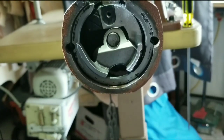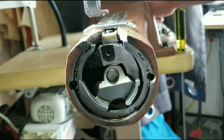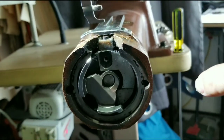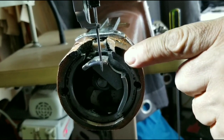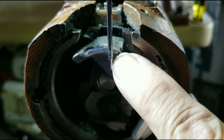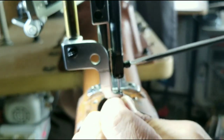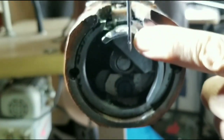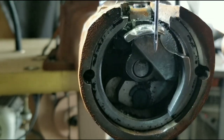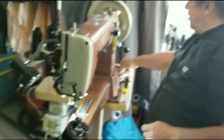Do we see any thread or unwanted material besides lint and oil? It's pretty gross and dirty in there — I should wipe it down. Now I'm going to cycle the machine so the needle is all the way at the bottom and double-check the deflector-needle relationship. We see the bottom of the eye is level with the bottom of the deflector. If the eye of the needle were below the deflector, the machine would be clearly out of time. We want the bottom of the eye level with the deflector — this condition is good, and the needle bar is basically in time.